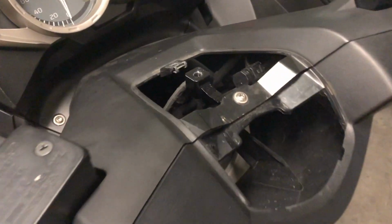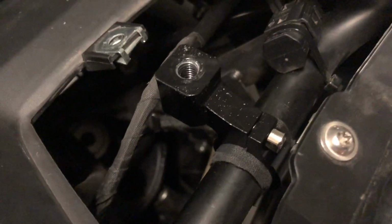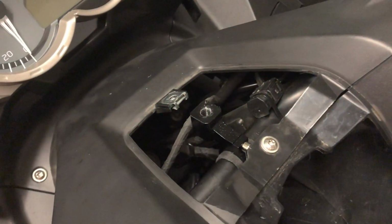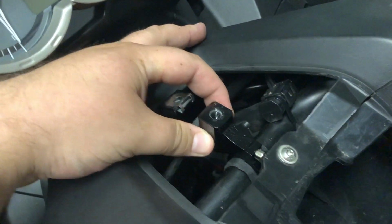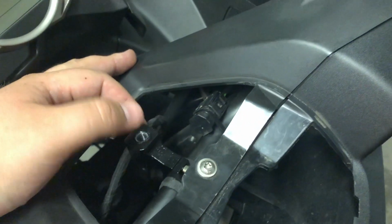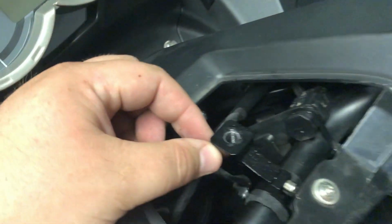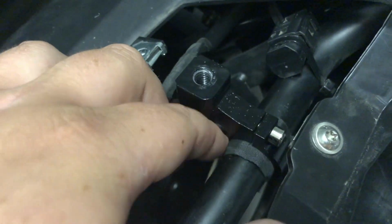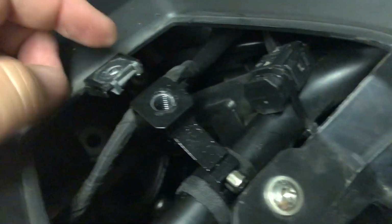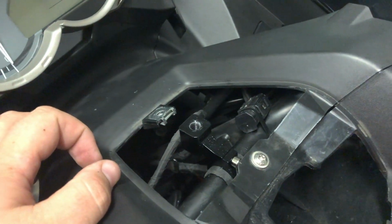So there's the holder. There's a threaded bolt. Actually, it's a mirror mount, as you can see. The cover has this hole right here. This is where the screw goes. But the one I made for the RAM mount is this one. This is actually a very sturdy one. It's made of aluminum, so don't go crazy Dwayne Johnson on your screw when you put it in there. Still gotta be tight, but not too tight. There's some rubber gasket around here, so it mounts very securely to the bar. I can shake it and nothing happens. And I like this because it is offset from here, because it would be right in the top, and I'll show you later why it's a problem.